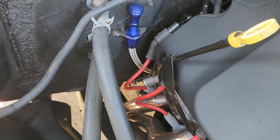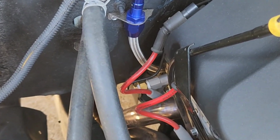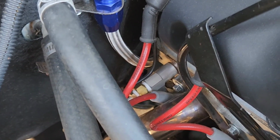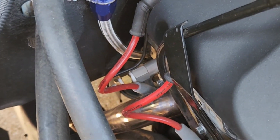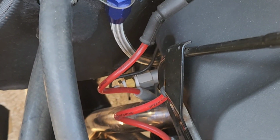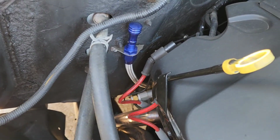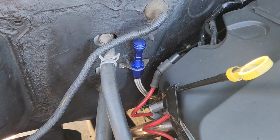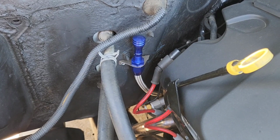As I was telling you about the temperature sensor, that's it right there. There's a provision that's not used in your passenger side head. Took that provision out, got an ICT billet aluminum adapter, and got the mechanical wire. It runs back up through the firewall. Works just fine. The 4L80 trans dipstick: I tried to maneuver it and get it to slide in there so it would come up proper, but I couldn't get it and got frustrated and finally said screw it.